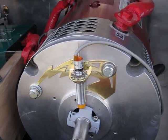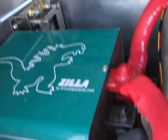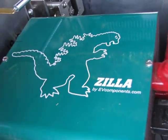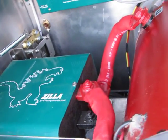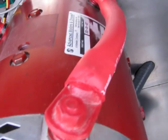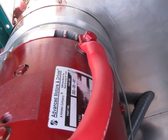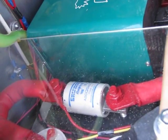Around back we have the ADC Advanced Motor 8-inch drive with some custom tachometer mounting and other custom brackets, such as the throttle linkage, the pot box, the Zilla hairball, and the Zilla — one of the very last Zillas to be produced, at least for a while. We used all four-aught large diameter cabling, so there's practically no loss in the cabling.